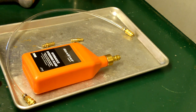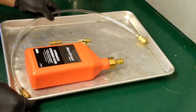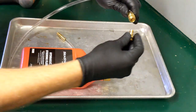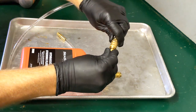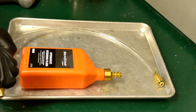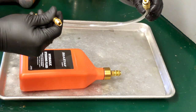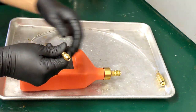Here we have our G2 kit, minus the bottle fill tube which we don't need for priming the cylinder attachment. We take the helm fitting and pop it into the end of the cylinder attachment right here — this opens up the valve which remains shut unless it's coupled with something. Then take our flush fill attachment and click it in there. Now with couplers in both ends, fluid, air, or whatever can move freely through the connectors.